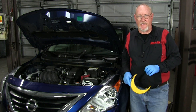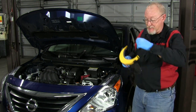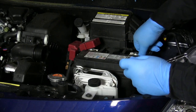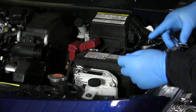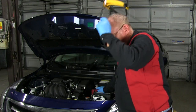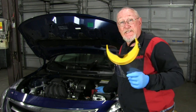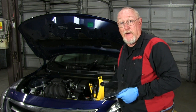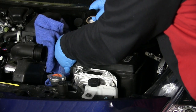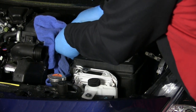Now we can disconnect the battery, but be sure to always wear your personal protective equipment when performing any battery-related service. Always disconnect the negative battery terminal first, then disconnect the positive battery terminal. The positive battery cable is still hot, now powered by the alternate 12-volt power supply connected with the memory saver. Be sure to isolate the cable end to prevent it from accidentally shorting to ground — a shop rag and some electrical tape work just fine.